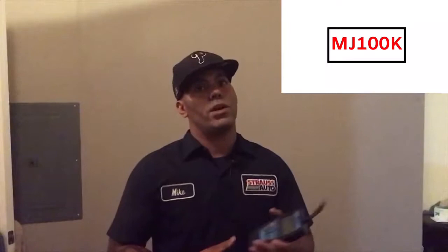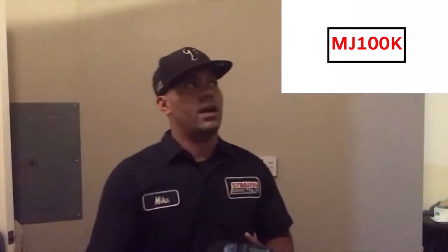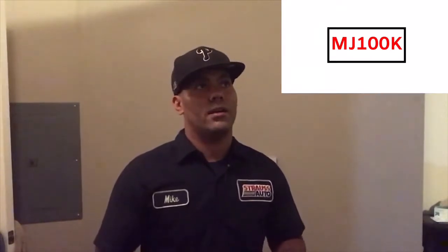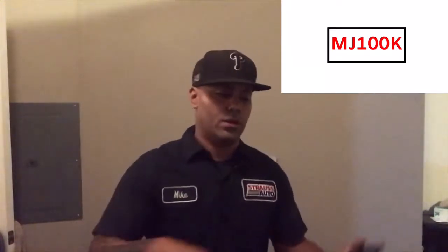So the first time I used the scanner at work at Strauss, I think it was a Honda Accord, and it came in for a diag. I was like, all right, well, let me try it. Check engine light's on. I plugged it in. It was O2 sensor 1 out of 2. So it was the first one, the one before the catalytic converter.